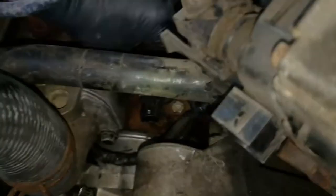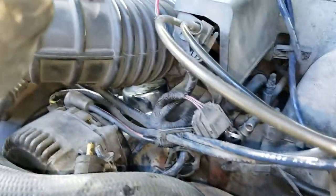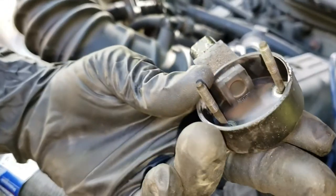This part is the electronic component of the sensor. Right, you can see it's just a little magnet, and you see it's kind of burned in there. And the plastic usually breaks down. This is where they usually die.